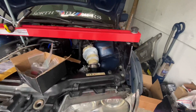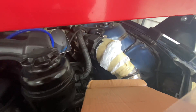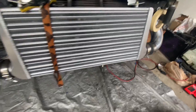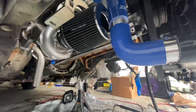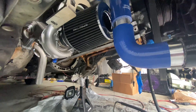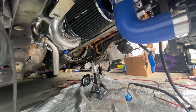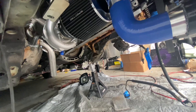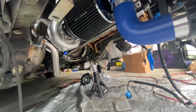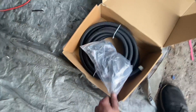The engine is lifted so I covered the intake with a bag and tape since those lines won't connect right now. Went ahead and put on the cold-side piping, clamped down most of the hot-side piping, put a filter on the turbo, and put on the wastegate piping off the manifold. Now we're going to cut that and mount the wastegate, then extend the tubing into the exhaust or just straight down.